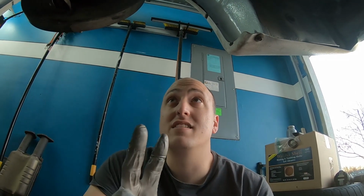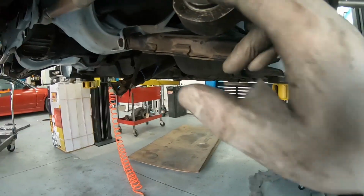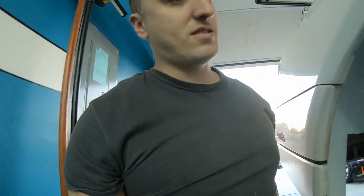That new hardware, 2 new bolts, 2 new nuts, and 4 of those washers cost about $17. Do not cheap out and get cheap bolts because you need a certain grade. Like these are grade 10.9, and I think what's on there is a grade 9 if I remember right. So you definitely want that, because you've got to think all your suspension, your whole car rests on that. So yeah, upgrade your hardware. These are for the ISR coilovers. I can't speak to any other ones.